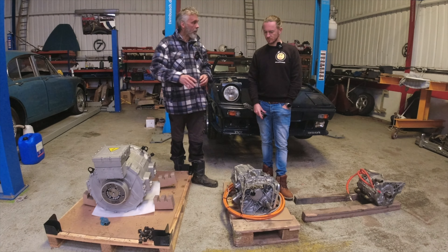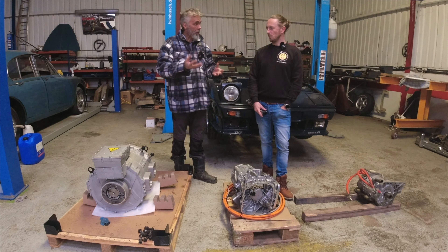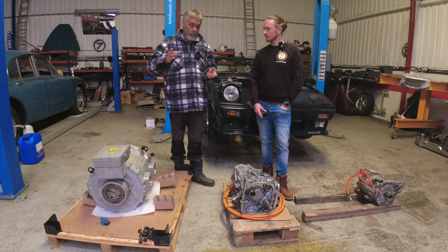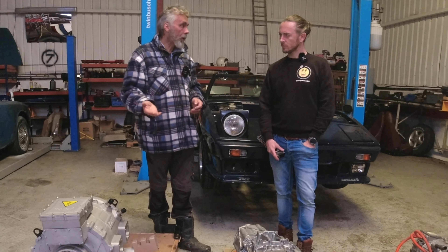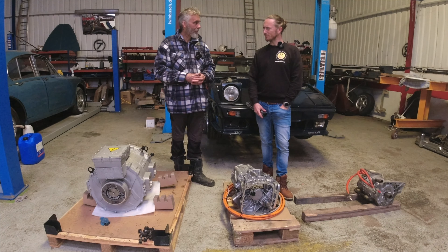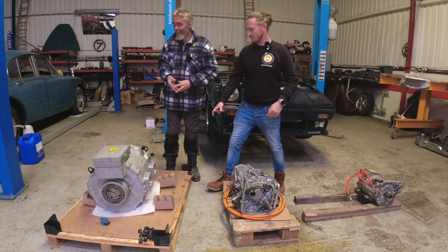What kilowatt-hour battery pack you'd need depends entirely on the vehicle and its duty cycle. For example, a dustbin lorry at low speed, just accelerating and stopping, could get away with maybe 100 kilowatt hours. But put that motor on a 42-tonne truck and you're talking 600–800 kilowatt hours minimum. Yes, commercial EV battery packs really do get that big. Awesome — thanks for showing us these motors, Ralph!